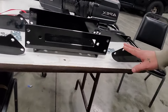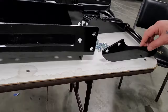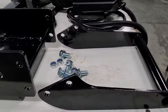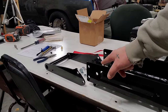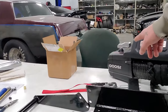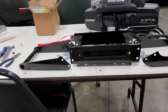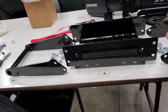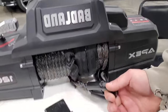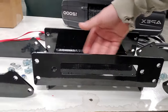These handles are different lengths — this one is longer than this one. I'm going to make sure to put the long handle on this side because my engagement knob is going to be on that side, and I want to make sure I have room for my knuckles to flip the engagement knob. I also took my hook off so we could slide the rope through our fairlead and into the slot that mounts to the fairlead. Let's get down to some installation.